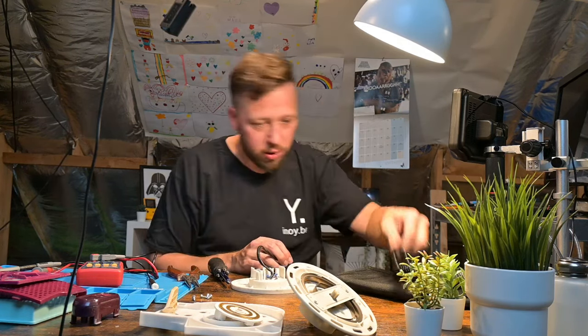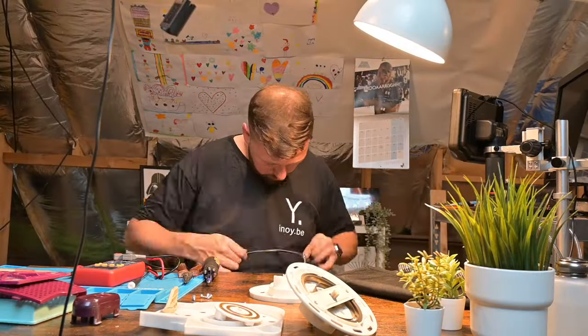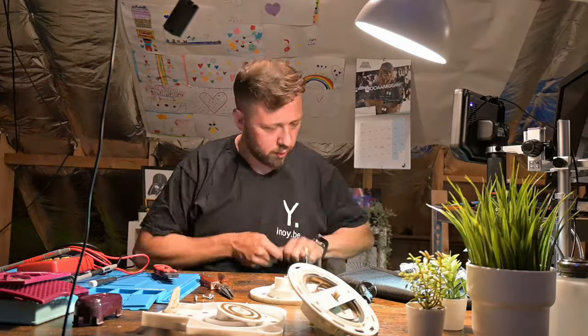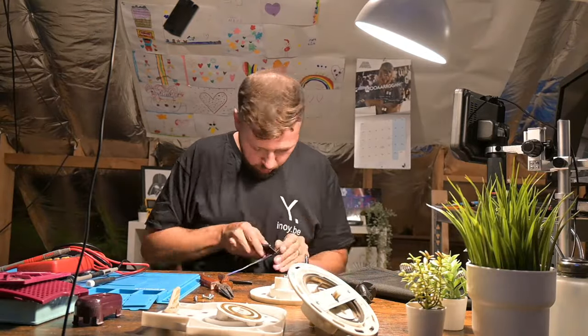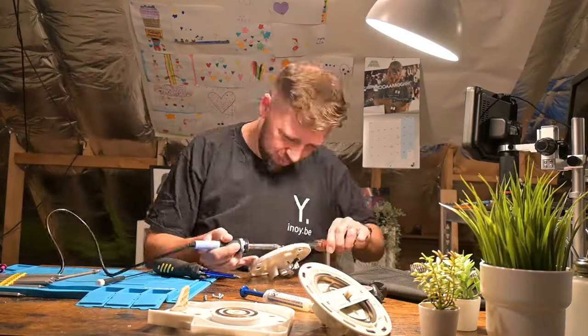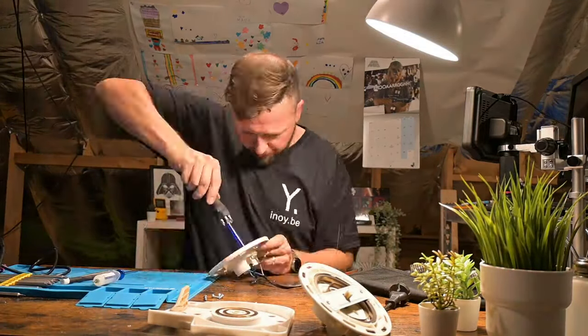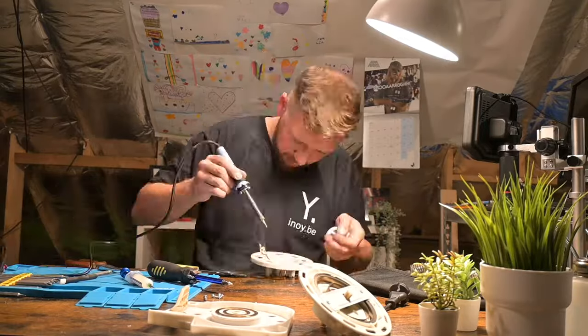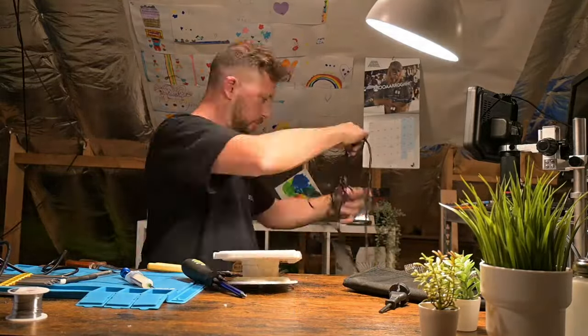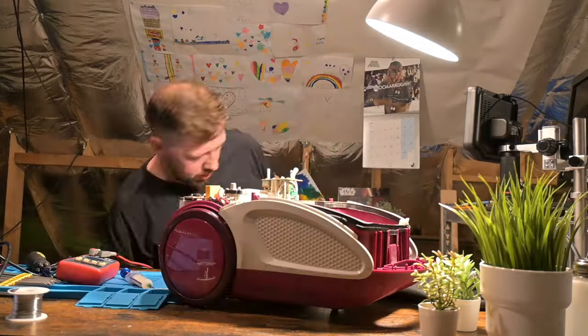The best thing would be to just replace the cable, but I don't have one that's long enough. Right around this moment I had an aha realization — the problem likely resided at the plug. So I decided to chop it off, as you can clearly see during this stellar framing, and tested the wires without the plug. Voilà — I had continuity! The damaged plug was the culprit. I wish I'd thought of that sooner.